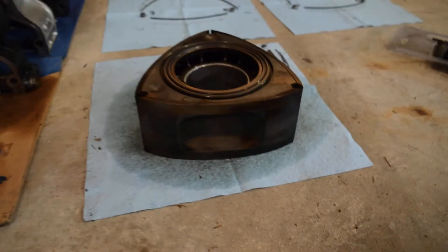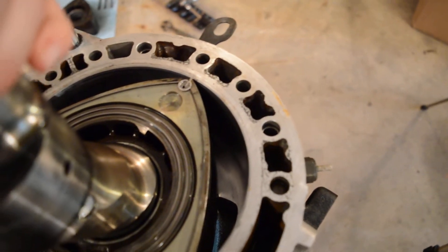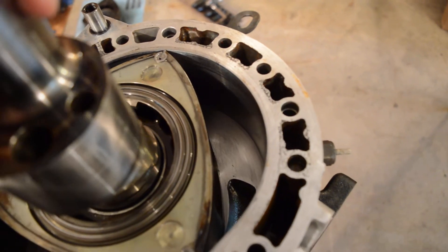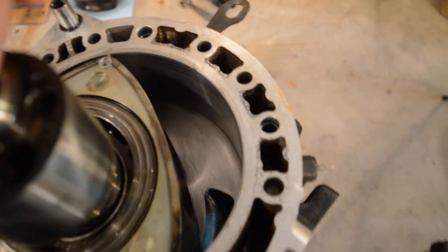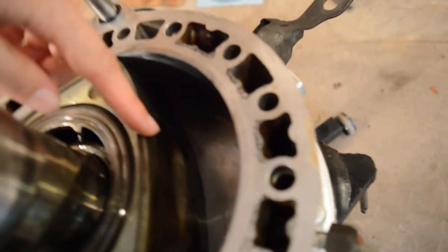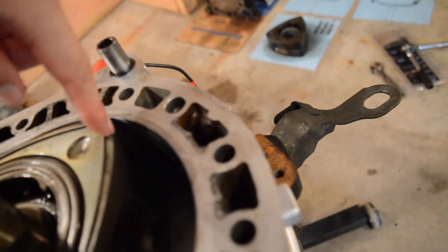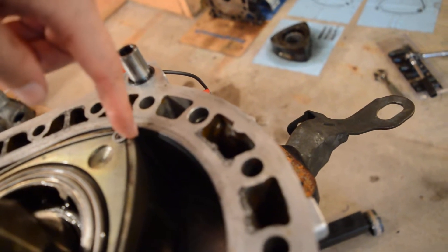You can see there's a recess on the rotor right here — see how it looks like that recess. So you have that recess and then the engine spins like this. You can get a better view of the cutout from the intake port and the recess of the combustion chamber, and these are your apex seals in here.